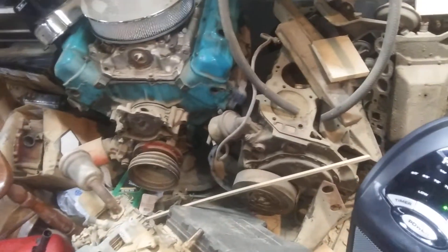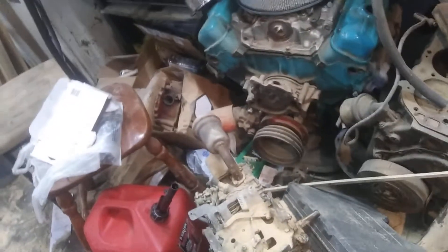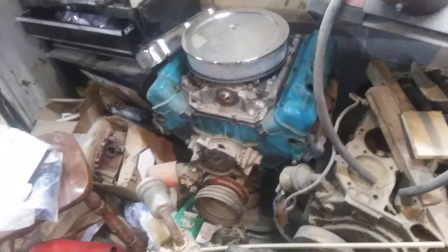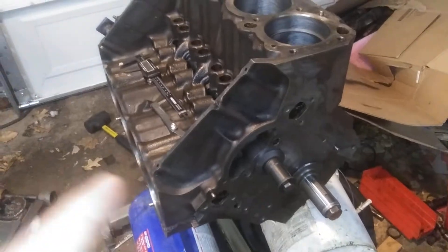That's the benefit of having low compression — being able to crank like 14 degrees initial timing on it, and just whatever timing your distributor happens to have. The ones I use have 22 degrees mechanical advance, so that plus 14 equals 36 degrees total timing. Put some lighter springs in there to bring the timing in by like 2,600 RPM, and it feels really snappy down low and off idle, especially if you have the accelerator pump tuned right on whatever carburetor you're using. Anyway, this video is about 8 minutes and 45 seconds of me just explaining nothing. Long story short, that engine exploded. This one's going in there. See you later.